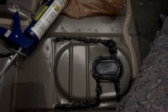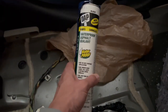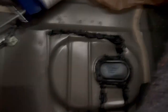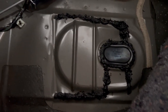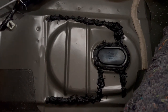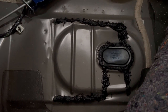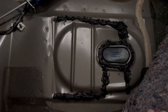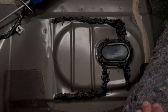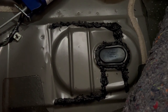We've basically got the job done. Once we dropped in the new fuel pump and reconnected everything, we took some waterproof asphalt sealant in a caulk gun and filled all the seams — pretty generous with the application. I don't think there should be any moisture or fuel vapors coming up through this region. Again, this is under the seat so I'm not too concerned. Cheers, thanks for watching, and hopefully this can help someone out.